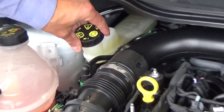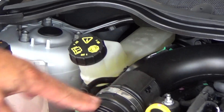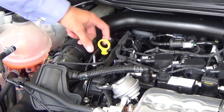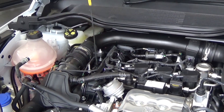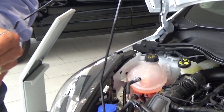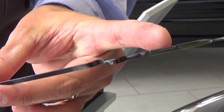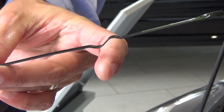You have brake fluid which is purely and simply a visual check to make sure there's fluid in there. And the engine oil dipstick is always marked yellow on a Ford on this EcoBoost engine — it's just here. On the actual dipstick itself you've got two tiny notches which can be difficult to see. As long as the oil is between those two notches then that's within specification.